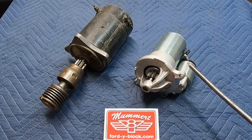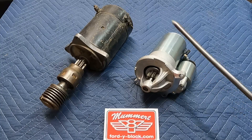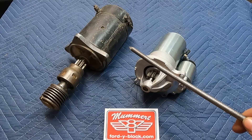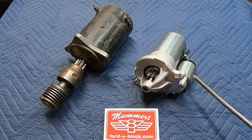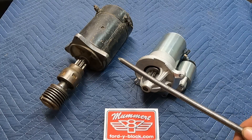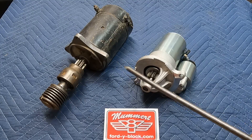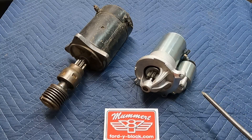If you're in the market for a new starter, look at something like this — it's just going to make your life a lot easier. These units here just weren't fantastic even when they were brand new. Really think about something like this especially if you're building any kind of performance engine. We had a lot of issues with these even trying to start decent performance engines; on the dynos at times we'd have to jump them with 18 and 24 volts — they were kind of a big pain.